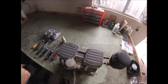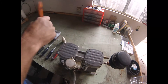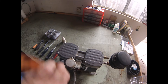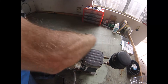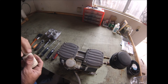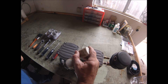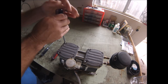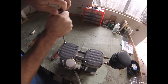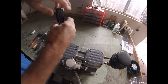The first thing I'm going to do is go ahead and dust off the compressor. Just to keep things from falling in it as we start pulling it apart, it's a good idea to do some good housekeeping and brush off the big stuff. The next thing we're going to do is squirt a little bit of WD-40 in the screws here. I'm going to go ahead and pull out our T25 star drive and get a little wiggle, let that solvent soak in there.